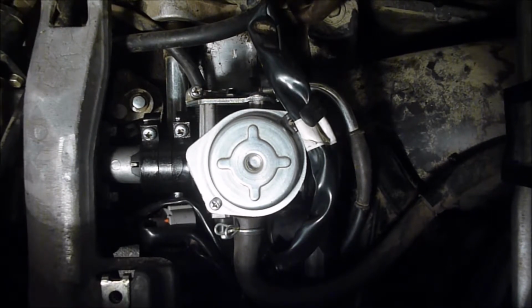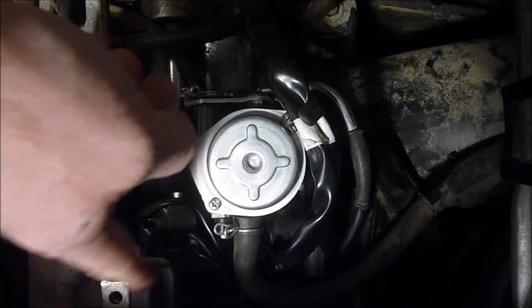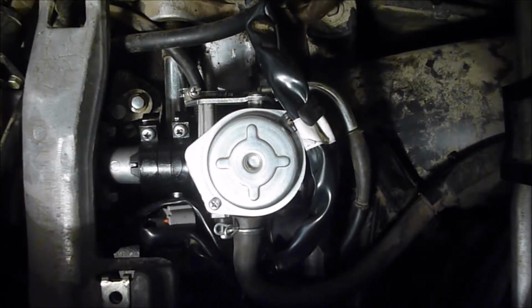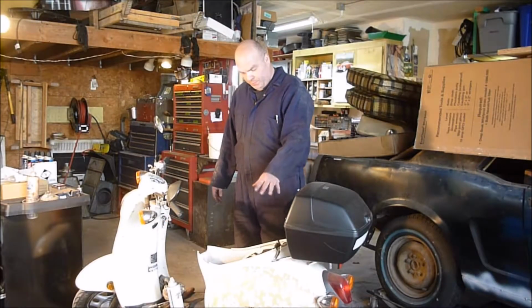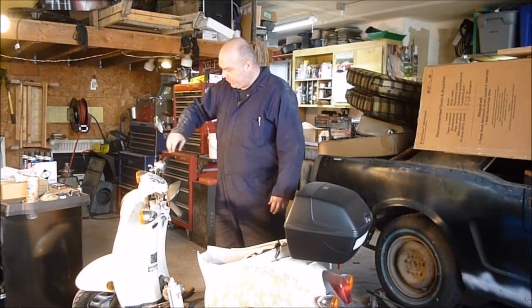Make sure the throttle goes through. That's another thing, you want to make sure if you let off of it, it goes all the way back. If you have any kind of binding, fix it now. Don't mess with a throttle that doesn't work. That's the first most dangerous thing I've seen people do. They'll have sticky throttles and not work on them, and I've seen a few people ride that way, just doing it by hand, and it's not a good idea. If you lose control, that throttle is wide open, you're in a mess of hurt. Anyhow, so it's in, we plugged everything in, we put all our hoses back on, everything in reverse. Got everything buttoned up, got the air filter back in it, because that can affect things as well. Now, the spider's making a nest already through here.